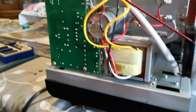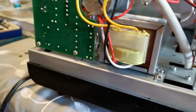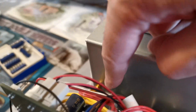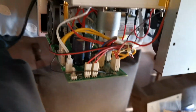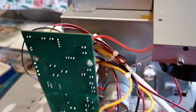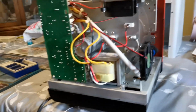Or obviously it's easy for the retailer to service. And here are the terminals here for your heating elements. Yeah, that's great. There's your LED. Here's your LED light strip, which again looks very easy to replace. And all the componentry, as is typical with the stuff made in Taiwan, is all Molex plugs or computer style plugs that just plug straight into the main circuit board, and the component fits with a few screws. So yeah, that's absolutely great. I was hoping it would be really simple inside, and it is.